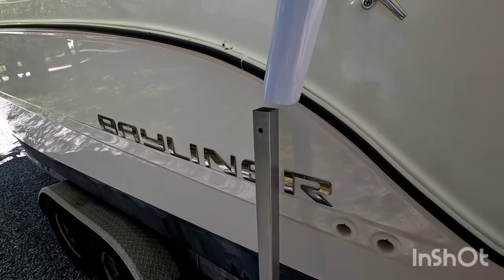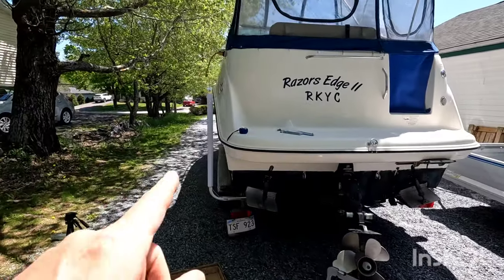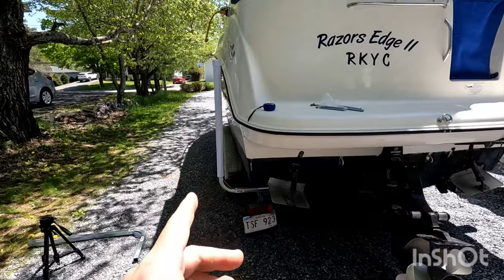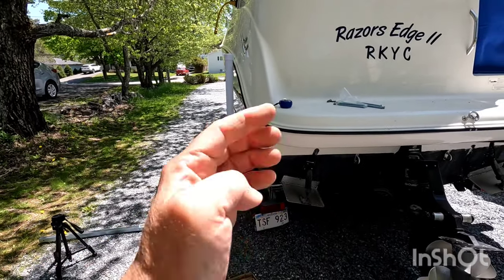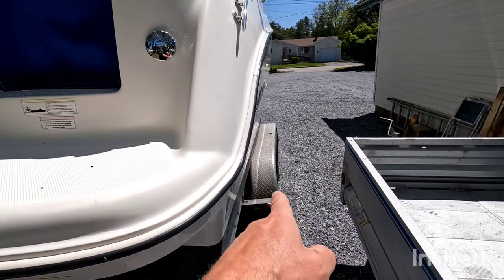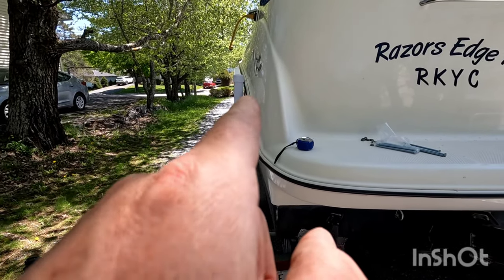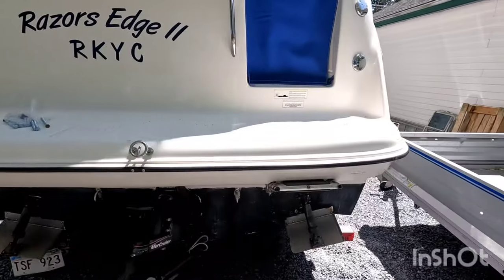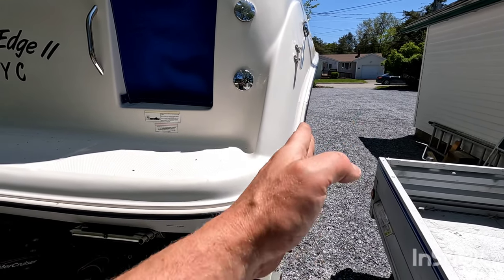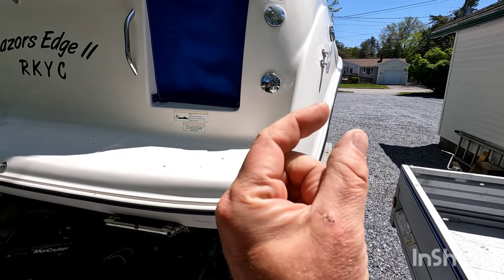Next, take this tube and feed it down — just like that. Before snugging down the nuts and bolts on the bracket, we want to determine how far out we want this. I'm looking at the trailer fender and I can see the boat actually has to shift over about an inch or two on this side. So I'm going to have this out probably an inch or two on one side, and about three inches on the other. You've got to make sure you still give yourself enough room to get your boat into the trailer — you can't have it too tight. You need a little bit of play on each side.